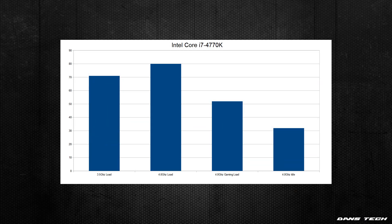The graphs are on screen now. At 3.5GHz on automatic voltage, 71 degrees, and then at 4GHz at around 1.08V, 80 degrees. This is the worst case scenario running Prime95. During gaming this cooler is quiet and gives pretty nice temperatures in the 50 degree mark. So very, very nice — I am very impressed and pleased with the cooler.